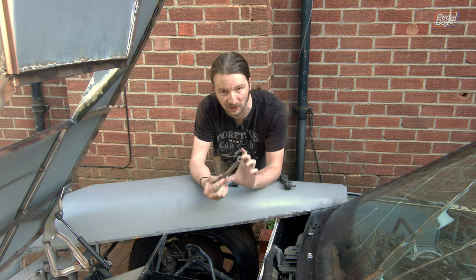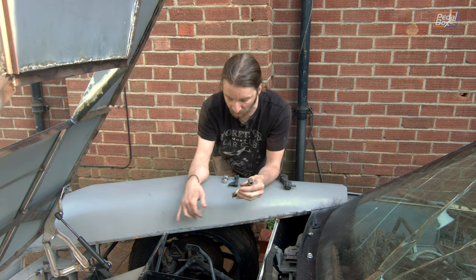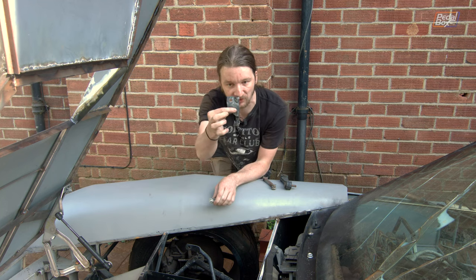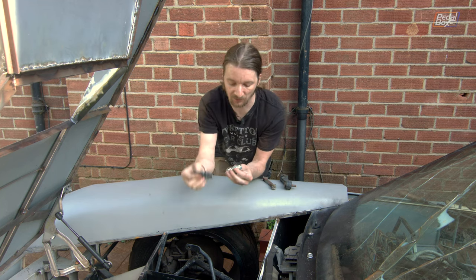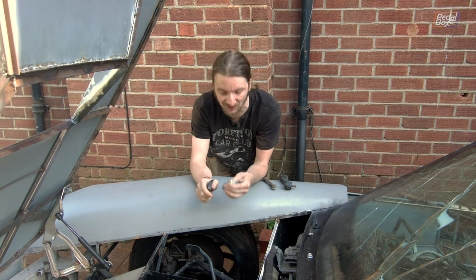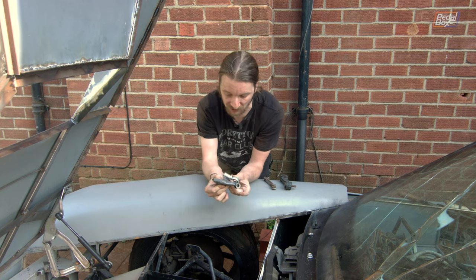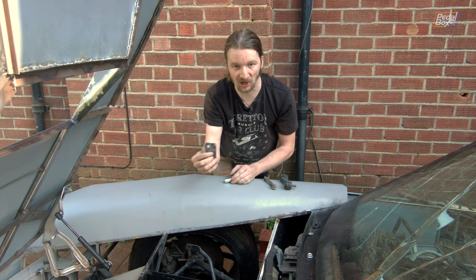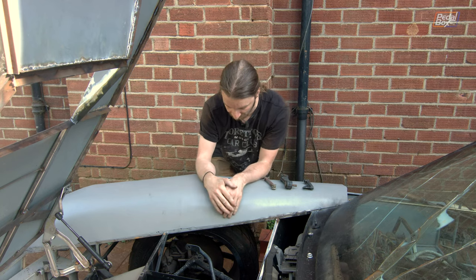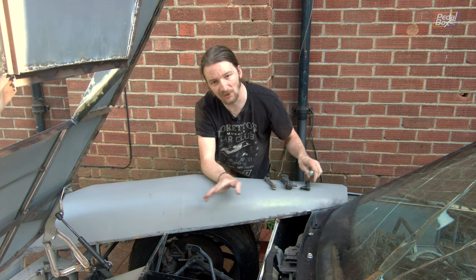A while ago we made up a little dimensional test to make sure we had all the offsets right for a static position — this wouldn't work in a real wheel because it has to lean back as the suspension compresses, but it was great for figuring out the length needed. This has been sat here for about 18 months until we could finally make a proper one. The idea is to have something that bolts onto the anti-roll bar with a heim joint on the bottom to fit onto our upper arm. The problem is we might have miscounted — we thought we had 10mm heim joints but all we've got is 12s. We'll build this with a heim joint in the bottom so it can bend back on that pin to track the ARB as the suspension compresses, once we get the right heim joint in.